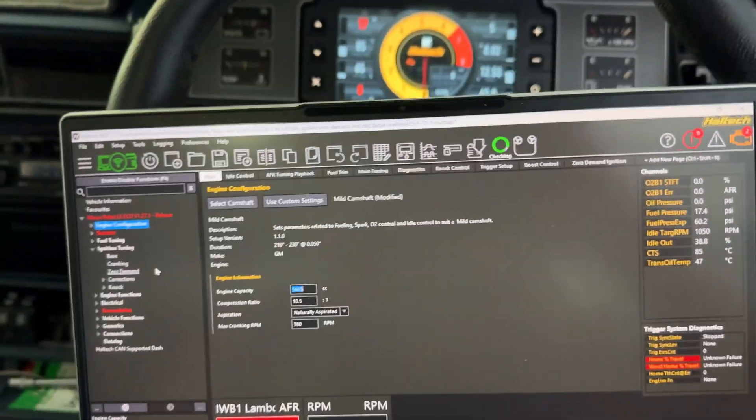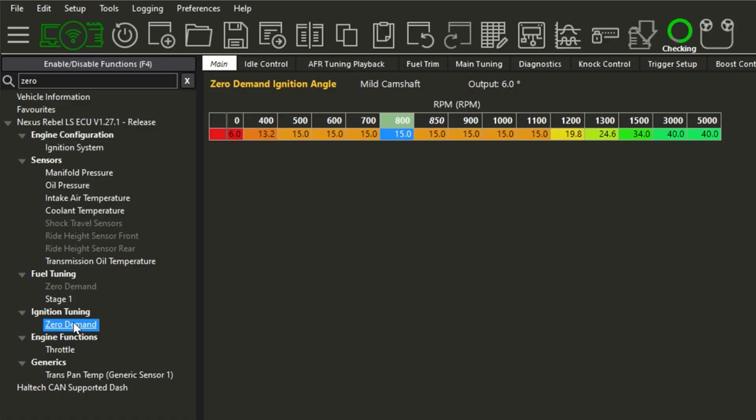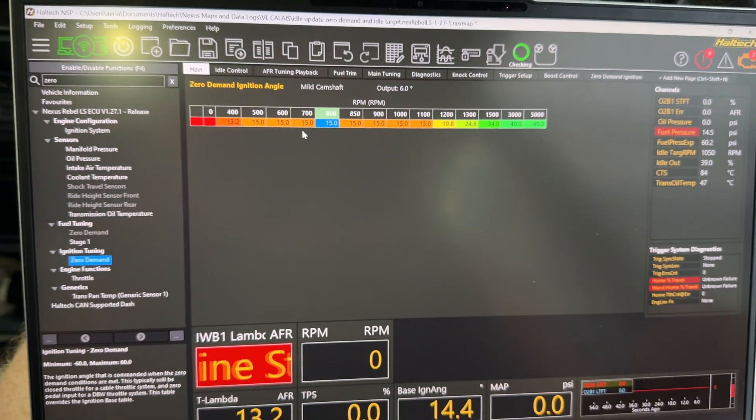So in the NSP software it's called a zero demand table. I've got my laptop here so I'll show you what it is. We're in the car and connected to the NSP software. If you want to go looking for it, search 'zero demand.' This is the map created by Haltech straight off the bat - you can see your RPM along the top and your timing underneath, your idle timing. Around our idle speed, which is about 800-850, the timing is all 15 degrees top dead centre. To create an artificial ghost cam sound, you reduce the timing above your idle speed so the RPM will fall, and increase it below your idle speed so the ignition catches it - your RPM is rising and falling, rising and falling. I'll start the car up and show you what it looks like.